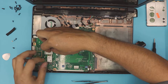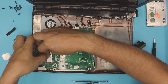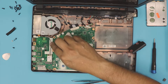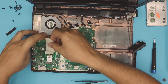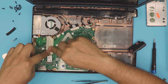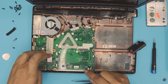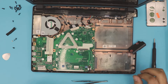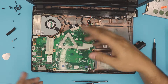Grab the white Wi-Fi antenna cable, place it right on top of the connector, and press it down — it'll snap in. You can leave the cable loose or tape it down with any masking tape. Trim the tape so it doesn't cover any components. Kapton tape or any similar tape works fine — some laptop models still use this type of tape from the factory.